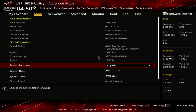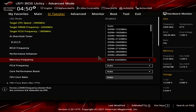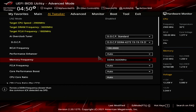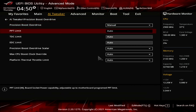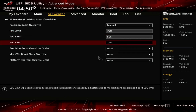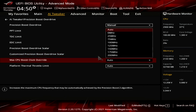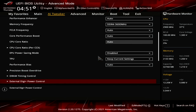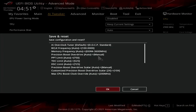After tuning, I used the following PBO parameters in the BIOS: set AI Overclock Tuner to DOCP Standard, memory frequency to DDR4-3600 MHz. In the PBO submenu, set Precision Boost Overdrive to Manual with PPT limit at 750, TDC limit at 525, and EDC limit at 725. Set PBO Scalar to Manual at 10x. Set Max CPU Boost Clock Override to +200 MHz. Leave the PBO submenu. Set DRAM AB and CD voltage to 1.2V, then save and exit.